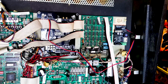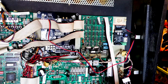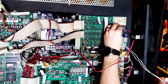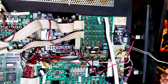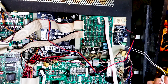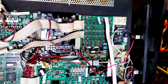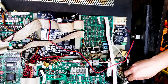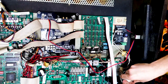Alright, once you have that one, then you have this cable. And they're labeled. So this is shaker power input. This is keyed to go up here. And then it says J101. And J101 is this one right here. So this is going to go into J101. It is keyed. And then you'll plug your original J101 into this split connection right here.